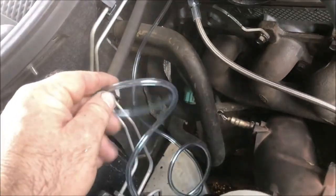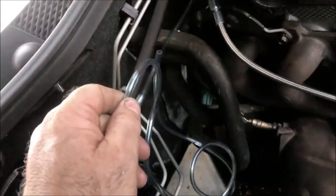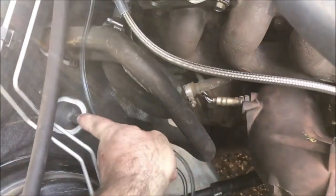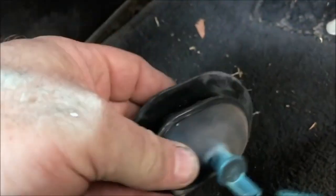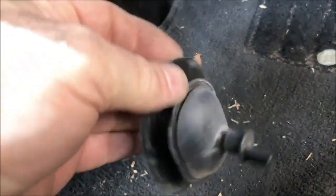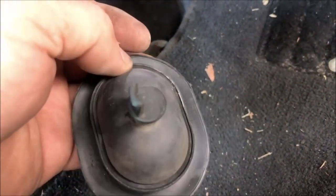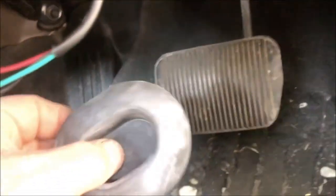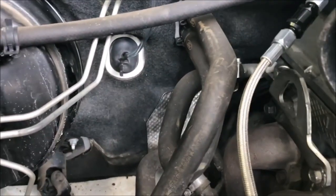For access into the cab, I need to make sure that's not going to crush the hose — because if this hose is kinked or crushed, we're not going to get an accurate reading on the gauge. There is a grommet here. I found that hole — it was nice and easy to get to, and I'm going to assume it's for a clutch pedal setup for a manual. So if you've got a manual doing this, you might have to find somewhere else. But on an automatic, I'm just going to drill a hole and run the hose through there — perfect, nice and easy. Nicely located through the firewall in an existing grommet and into the cab.